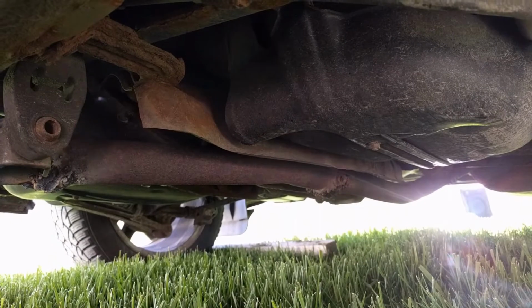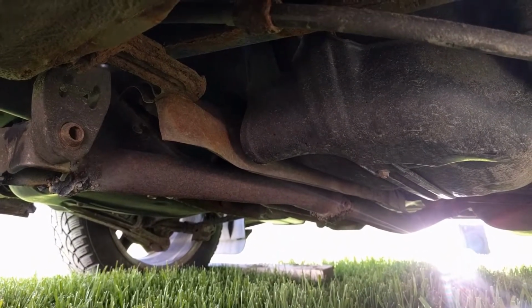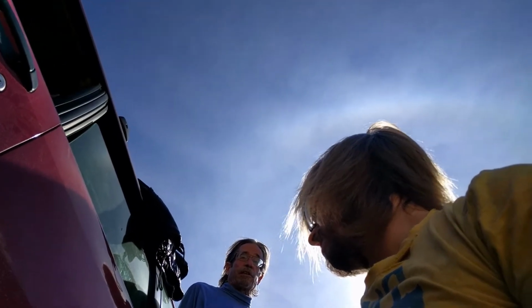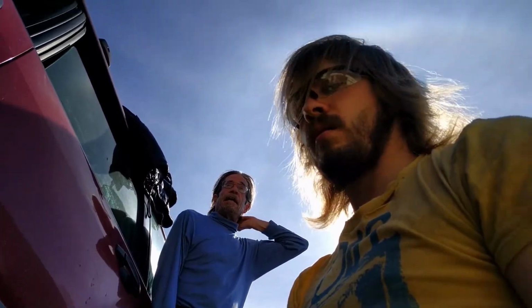The big leak is out of the joint back there. That one's damned impossible to reach still. With a brazing torch, I can wrap brazing rod around the top, melt it, get it hot, add to it, and know that I've got at least runoff into a lot of the small places. But Nate turned me on to this muffler bandage I did Heather's with. You wrap it up, and as soon as it heats up, it turns to porcelain.